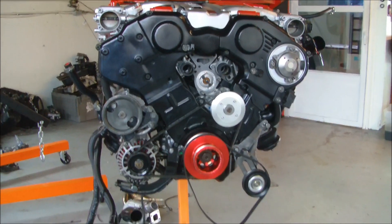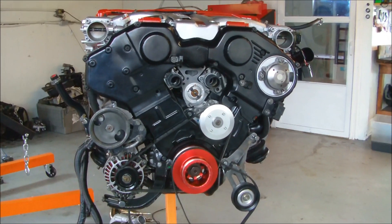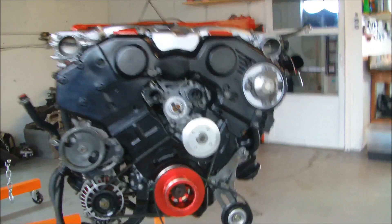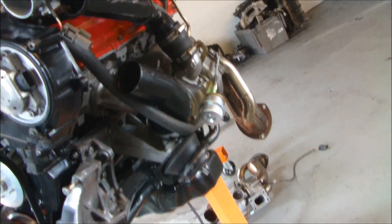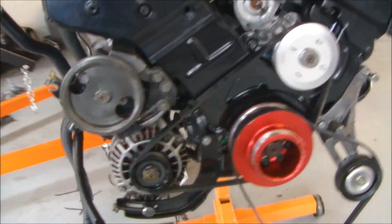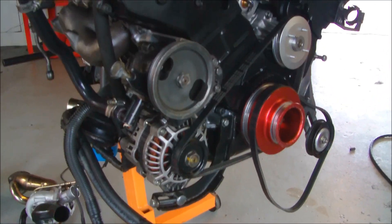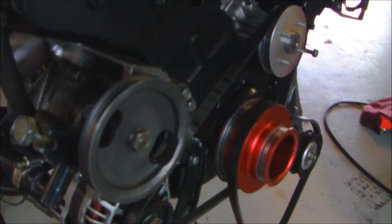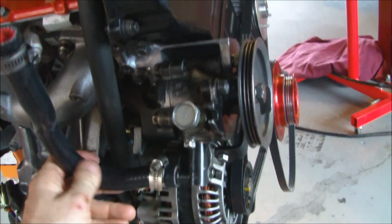Giving Joe a look at how much further we got on the motor. We got a few minor problems to take care of. The last time you saw, we had this side of the turbo all buttoned up — that's all done. We had the AC bracket put on, got the power steering on and the alternator on. Then as I started fitting the belt, I noticed that this power steering with the brand new J hose is an NA power steering.